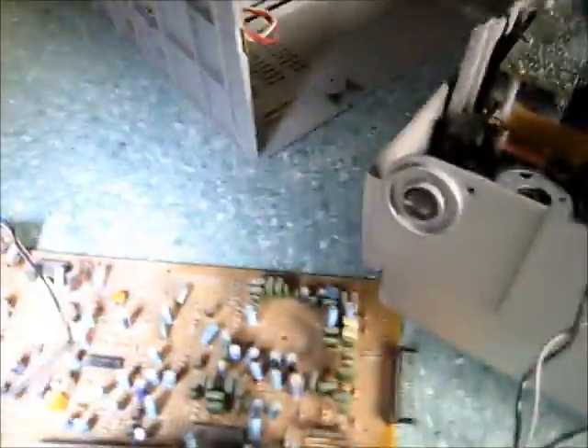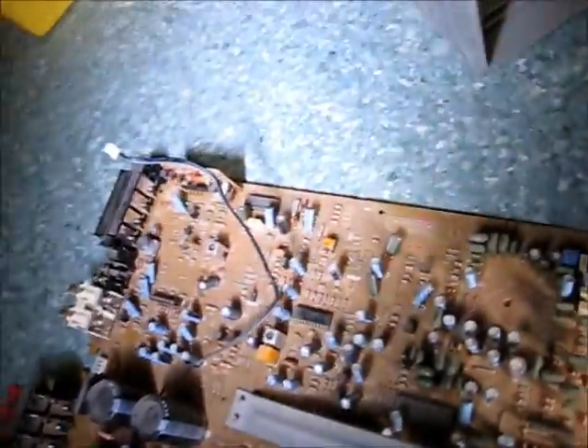I've got the stereo taken apart. It's pretty nice to see how it all comes apart in a certain order — how all the cables just plug in like that. The hardest part is remembering how it all goes back together. Before I touch that in there, I'm going to check this for dry joints. There's our Dolby Digital Surround Sound chip down there. I see a crappy joint there. It is made in China, this stereo.